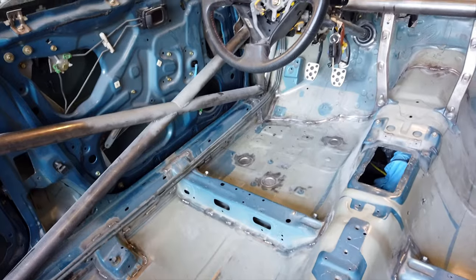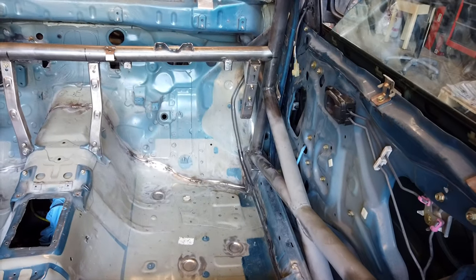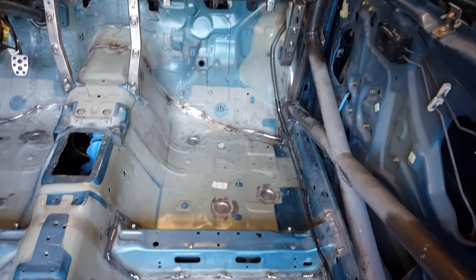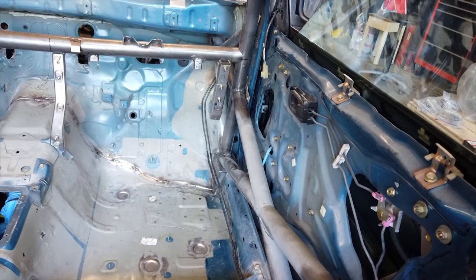Now if you guys are still hungry after that, we may have a little digestif, as we call it. We've got the brake lines on the right and the fuel lines on the left, which are both hard lines. Due to the recent revision, these do not route correctly — they basically interfere with the roll cage. There's no really good way to bend them around it, so I need to completely cut those lines out and replace them with AN lines and proper AN fittings. I've ordered those but don't know when they'll arrive. So if they do before the end of the video, great; if not, it'll be for later. Stay tuned.